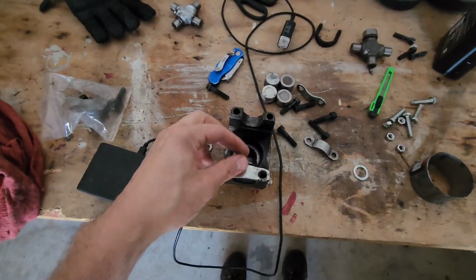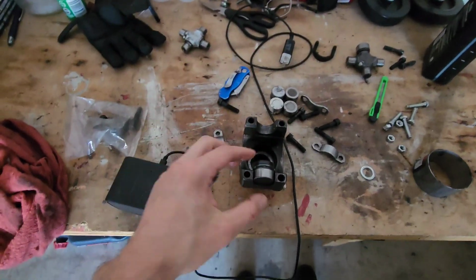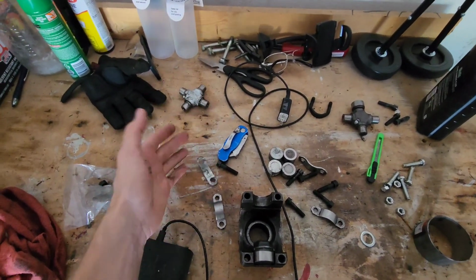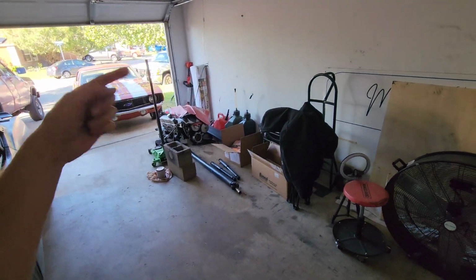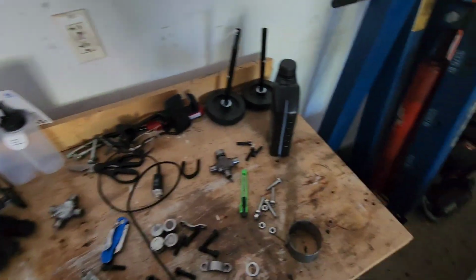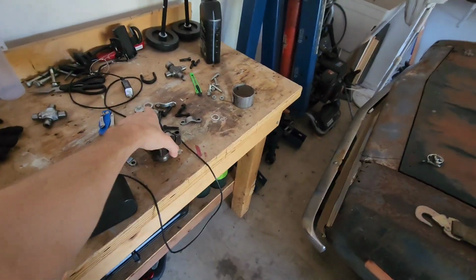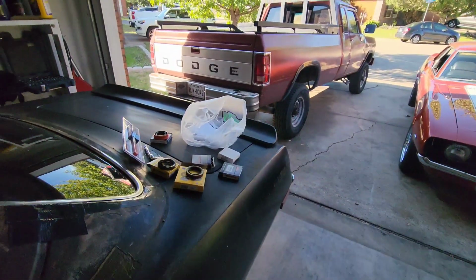But I have these smaller ones that I kind of forced to fit before, but these caps that I made fit, and these caps that came off the old drive shaft are what I had on it in the last video when it fell apart. I don't know. I got the snap rings to seat on the slip yoke side of the drive shaft. So maybe that's what's been causing the whole falling apart issue, was the vibration was just going down the line. And I'm gonna throw those in, which might end up me coming back to just saying, well, okay, we got the old yoke in and the old seal in, and we're gonna try it and see what it does. So let's get more head banging on the wall.